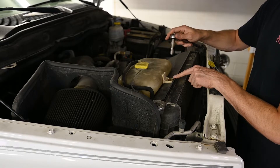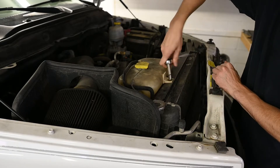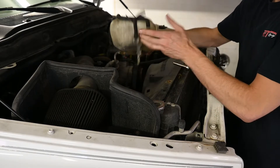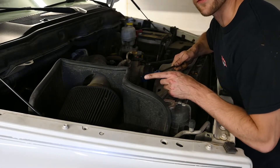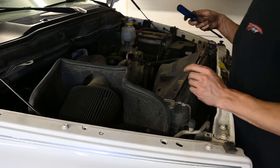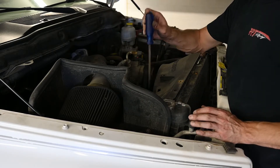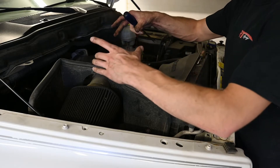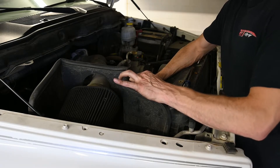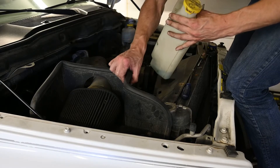All I should have to do is take this 10mm bolt off to get my old coolant reservoir out, get that out of the way, undo the hose — the overflow hose to the radiator — and that just pops right out. I've gone ahead and drained the fluid left in the washer fluid bottle using some spare cups. Using a long screwdriver, I pried the bottle away from the shroud a little bit, which disengages the clips, and then you can pull up from there. I've already taken out the sensors and the pump — it's a bit of a tight fit with the K&N guard on there.